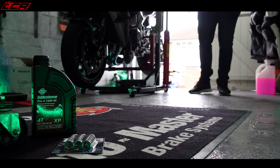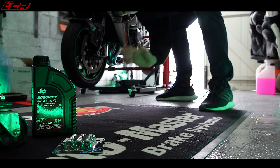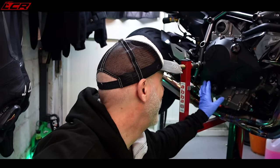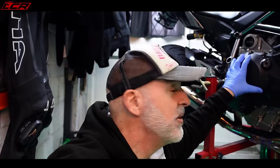Morning! The bike is now nicely drained. I think we've got every last bit of oil out of this machine now. Now I want to check the clutch and try to improve it. As I say, the bite was right at the end of the lever and it annoys me. I think when it was dynoed — because it's 240 horsepower now — the dyno may have given the clutch quite a hard time.